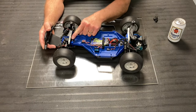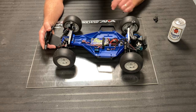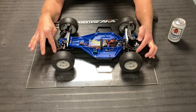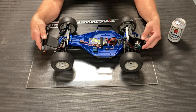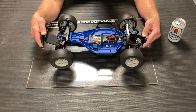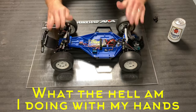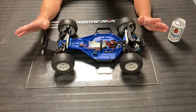I actually have some electrical tape in here because that's just genius to keep the bar from sliding side to side. I wrapped it around the middle of the bar. I actually have the links on these pulled in kind of tight, and it acts as limiting straps. So when the truck is going in the air or around bends, it limits how far the wheels can drop down, keeps it planted, thing is dialed.